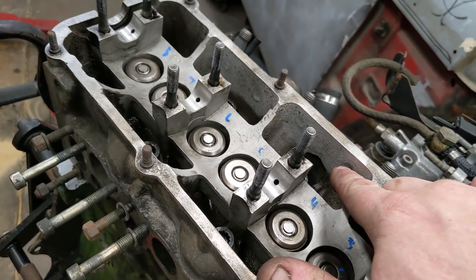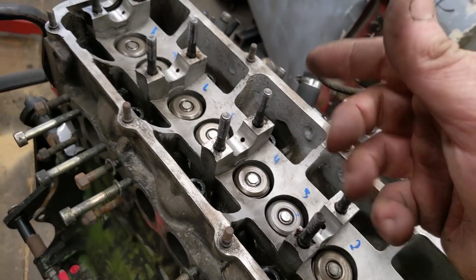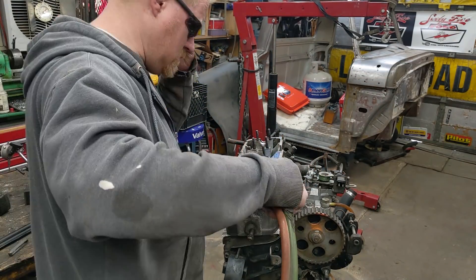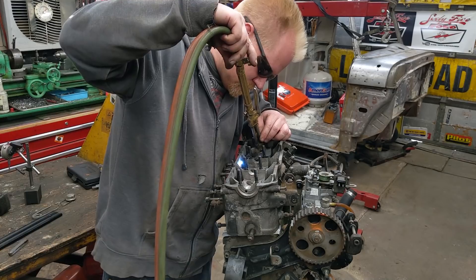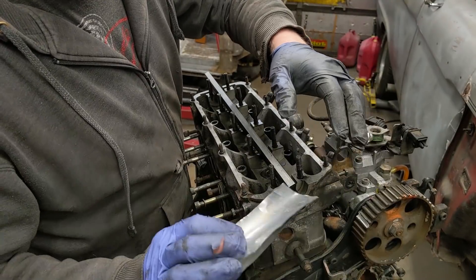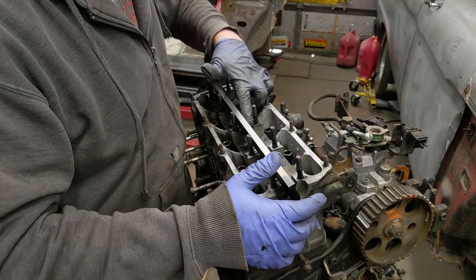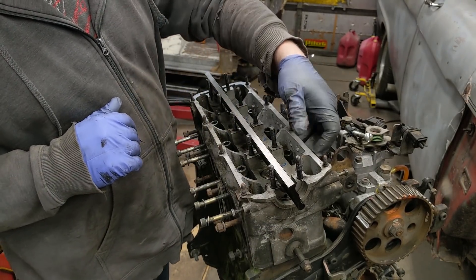You can see some of my heat spots. I got a little carried away with one, but most of them look fine. I'm just gonna heat in between those spots on both sides. I heated it a third time — doubled up my shims to two on each side, so roughly 8 thousandths on each side. It bent it down about 5 to 6 thousandths low in the middle.